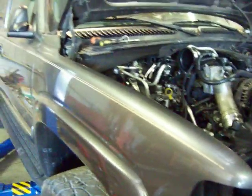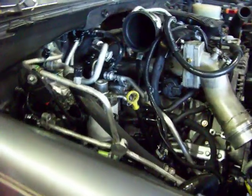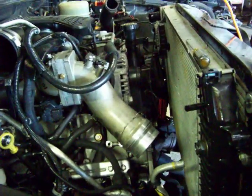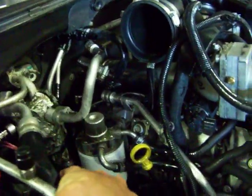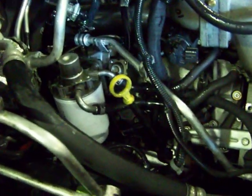And that's what we wanted to share with you today, is that there's a reason why more people come to DuraBurb than to anyone else for Duramax SUVs in the country. It's because our work is superior. Well, taking a look around this vehicle, you'll notice that the individual that put this together didn't know how to hook the rear AC up, so they tied in a rubber hose on the high side line with some hose clamps and a bolt. Obviously that's not acceptable, so naturally the suction line was not hooked up either. That kind of workmanship is just unexcusable.